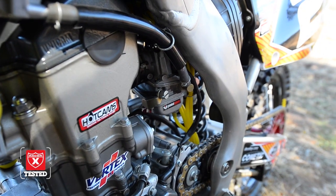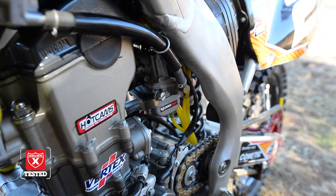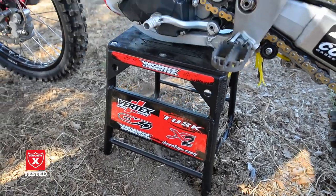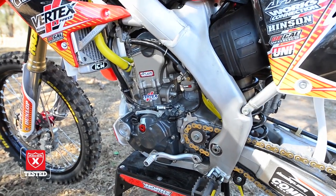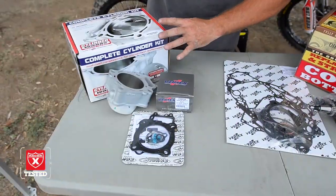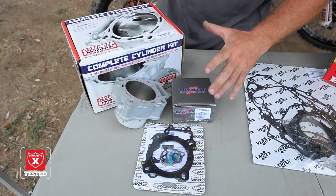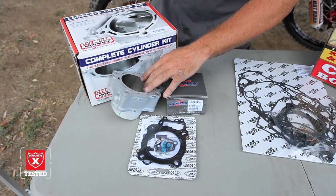For the carburetor we used an 04-05 carb. It's a lot smaller than the 06-09 carb, a lot easier to jet, and a lot better at getting rid of that bog. CV4 has their X2 line of valves and springs for the head, and that's what we replaced all the valves and springs with. Since our head was still in good shape, we just put new valves and springs in the motor. The Cylinder Works kit comes complete with a brand new cylinder, top-end gasket kit, and Vertex piston — a really good option when you need a whole new top-end and cylinder.